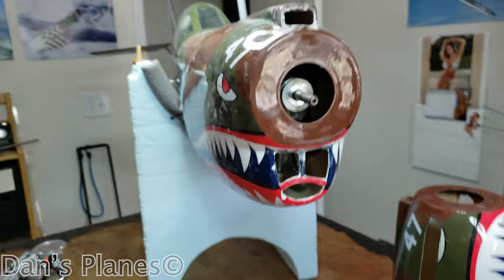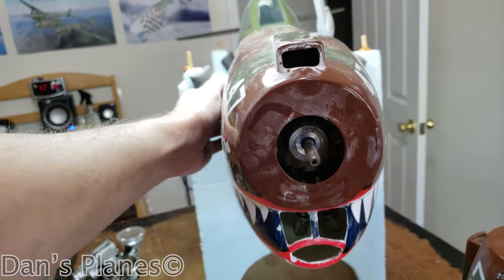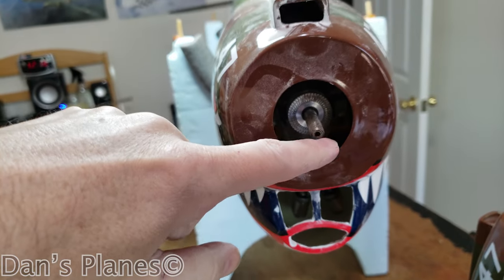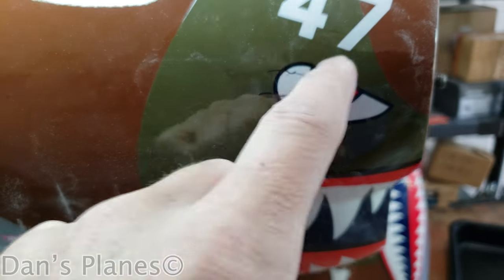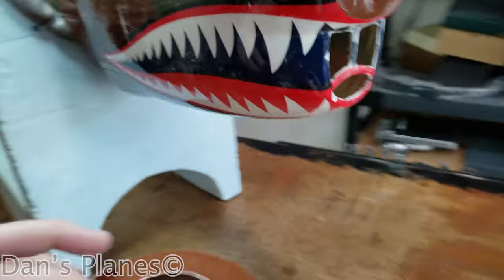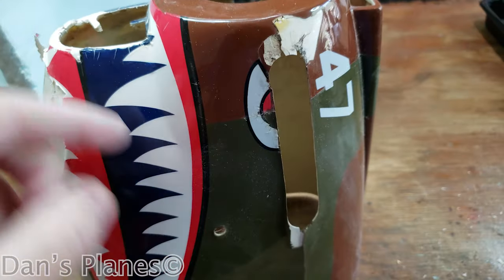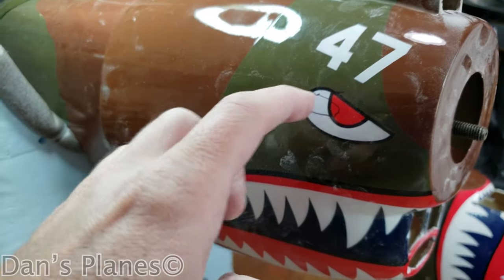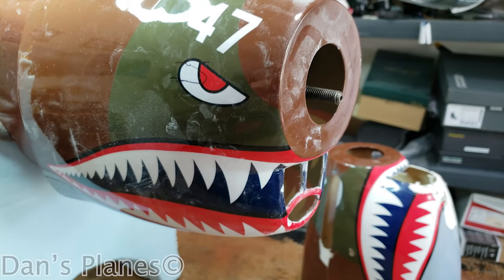Now I need to cut out the exhaust ports. I line up my cowl so everything is straight like it needs to be — this part goes straight back and centering in this hole. Then I mark on the sides where I need to start cutting the exhaust. I noticed on my new cowl and the old cowl — interesting — on the right side it cuts away the eyeball, but on the left side it leaves half the eyeball. It's kind of cockeyed, but both of them are like that. So I'm going to cut away a section, make sure I'm on the right track, put it back onto the airplane, and then draw the next part that I need to cut away.